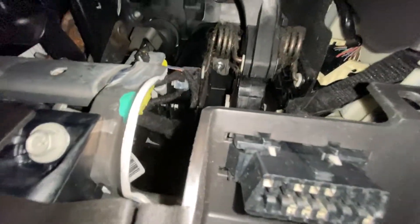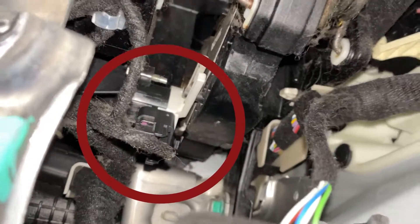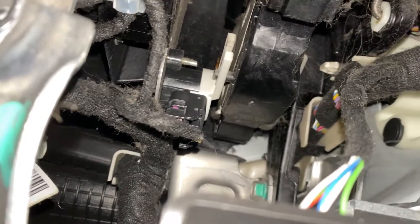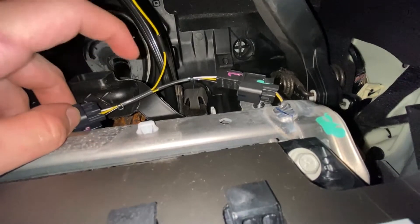Since it's so tight down here, I can't really get my actual camera in. I'm at the clutch pedal right now — if we zoom in a bit, you can see that is the connector we need to get to. The little white arm is what travels with the clutch. We can pop that off and put our inline harness in so we are tapped on the right signal. This is our inline harness — I had to extend it, so that's why that's there.